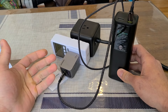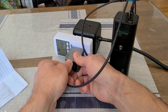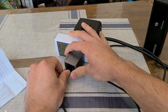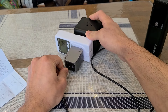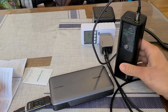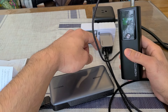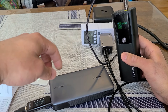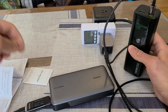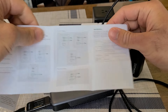I'm not going to test the Type-A port for single-device charging because to use the full 22.5W, the device needs to support the correct protocol. Moving on to dual-port charging: I have a RAVPower power bank charging from C1 at about 43W, and a UGreen power bank charging from C2 at about 20W. That matches the power allocation spec of 45W and 20W for two devices.